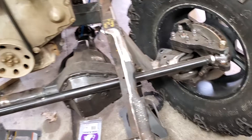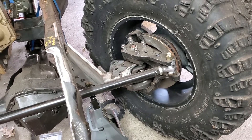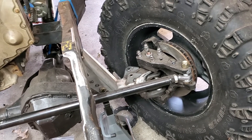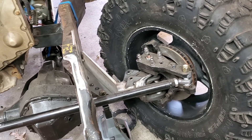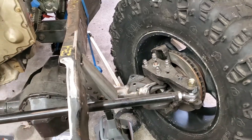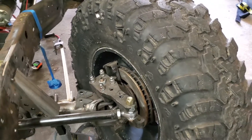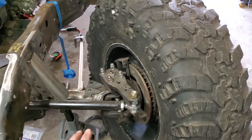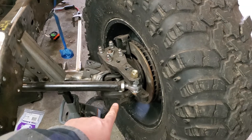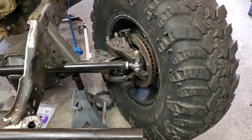Something to keep in mind: where you set your steering locks does determine how much steering angle you're going to have. I've got it set a little conservative — I certainly could go more, some would go less just to protect U-joints. We want to make sure that when we're set and done with our steering box, we have enough travel that if I did decide to go to a higher degree of turning, I'm not limiting my steering box — that my steering box isn't actually contacting the steering stops on both sides. That's step one: I determined 8 inches of travel.